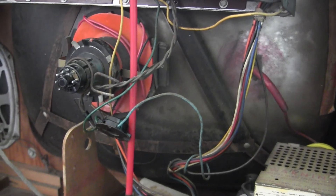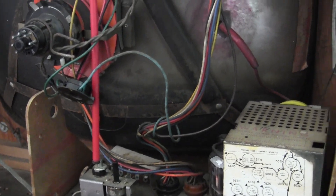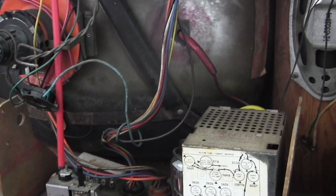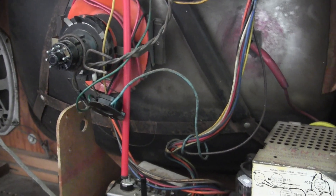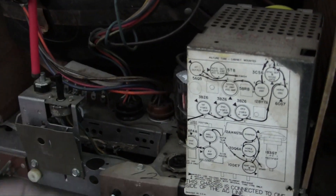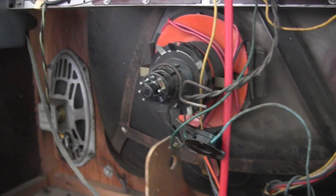I can't work on this now but I'm very psyched to. I know you want to know if the halo light bulb is good — so do I. It's probably a separate circuit, but notice there's no control on this set for the halo light. Looking at the service info there were three flavors: one had a variable dimmer control, another had a couple of positions, and I think this might be the simplest version where it's just on all the time, or there might be a jumper inside to disable it. I don't think there's actually a switch or knob for it, but I won't know for certain until I dig further.